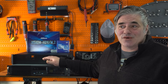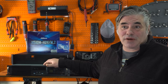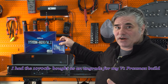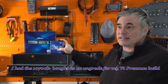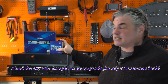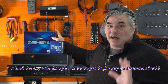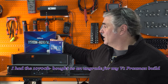Quickly, it's a 9900K. It used to be my editing PC, used to be my gaming PC, and now it's my Proxmox server, but I'm stealing parts from it. Now, the hardware for the new system is going to be an ASRock H510M Micro ATX and a 10700K. I was initially planning on building her new system with a 10700K. The problem is Z boards. Even ATX boards are really hard to come by and really, really expensive. This wasn't that expensive. So I'm like, okay, I've got a Z board for the 9900K. It overclocks to 5 gigahertz. Just swap that in and she'll be fine. She doesn't play intensive games. She plays Sims and Rainbow Six Siege with her boyfriend. So we're going to do that.